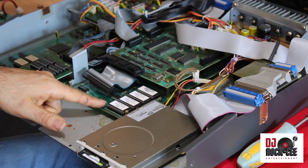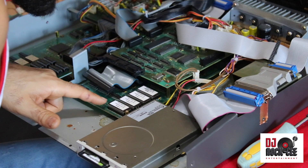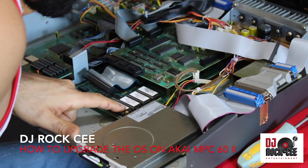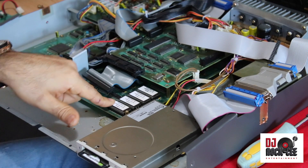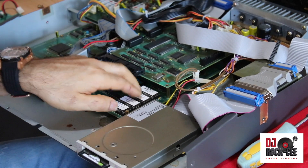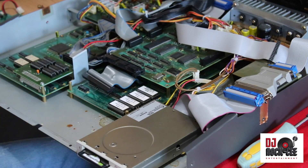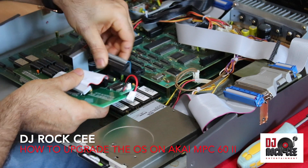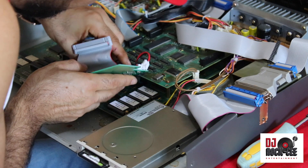All four chips are in now. Just make sure that each contact is inside the hole — if anything is out, pull it back out, straighten it, and put it in properly. Now it's time to reassemble. The first thing you want to do is connect the ribbon cable, then connect the top ribbon cable.